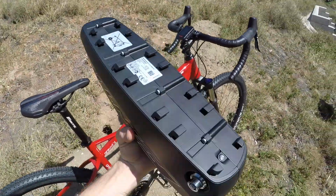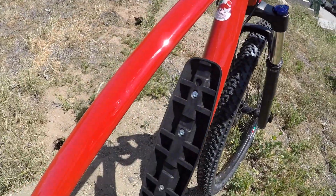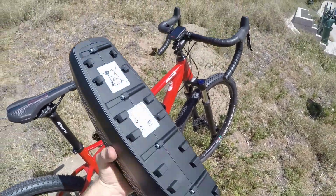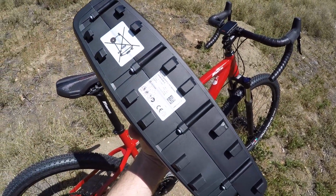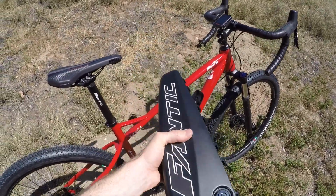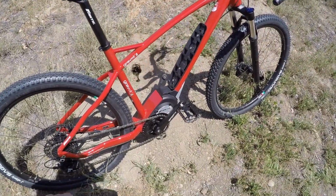You can see beneath, it's got those plastic fingers, quite a few of them. And then look at that, 4 bolts holding that onto the frame. So it's much sturdier, and probably rightly so for a mountain bike, than a lot of kits and other things where there's only a couple or a few bolts. It's 36.5 volts, 11.4 amp hours, 416.1 watt hours. It's always a trade-off between weight and range and stuff. And I feel like the Brose T motor in particular spends that energy very efficiently.